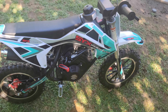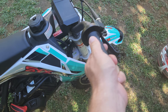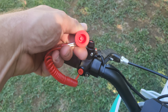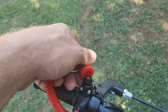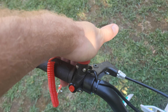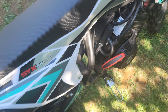Through the plastic and the fuel filter. We want to make sure we don't have the throttle on because the motorcycle will take off on us if we add throttle — you pull it back towards you for throttle. We have the kill switch engaged, so there's a piece of rubber that presses down on that, which tells the engine it's okay. It completes the circuit; when it pops off it breaks the circuit and kills the engine. So we need to have that pressed down nice and tight to close the electric circuit and allow it to start. We have the choke off, so we're going to go ahead and pull.